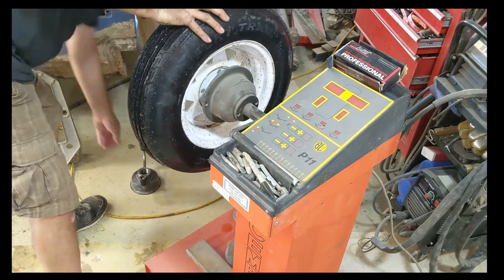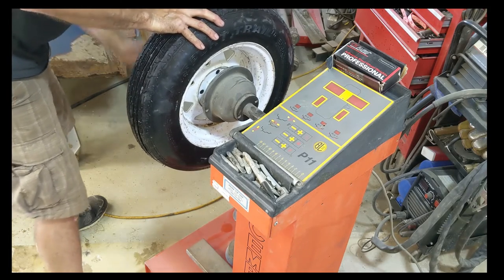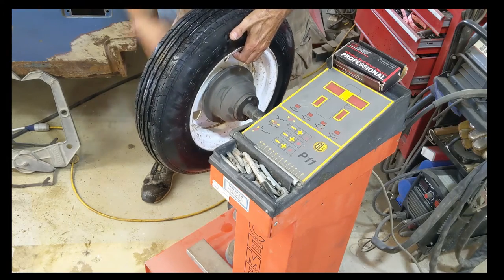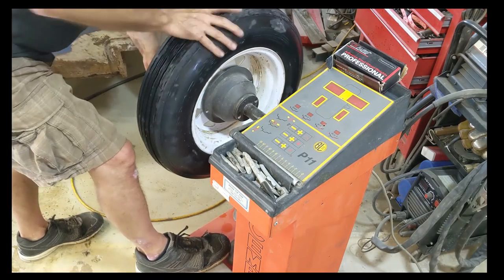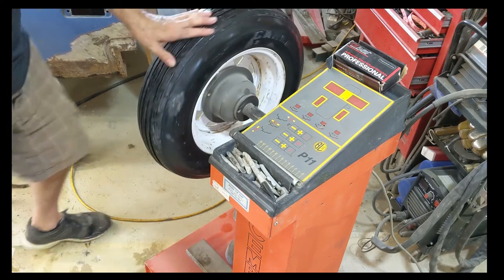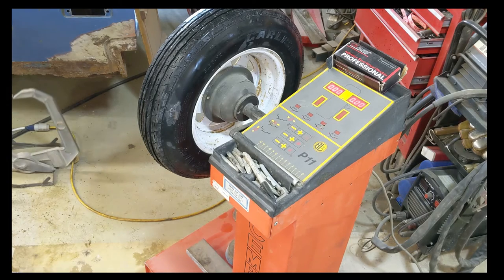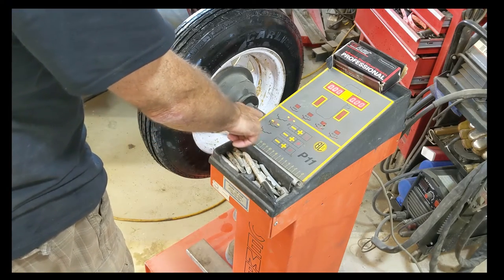Let's get her on here. Pull her up a little bit so she doesn't rub on it too much. This one's got a brake on it, so I'll put the brake on. Snug it up good. I had this plug — oh, I've got to turn it on. There we go, she turned back on. I'll grab my caliper — I'm going to need it to set the D setting on this balancer. You measure from the inside of the rim to the inside of the rim. This is a four and a half, so that's the depth of the rim.